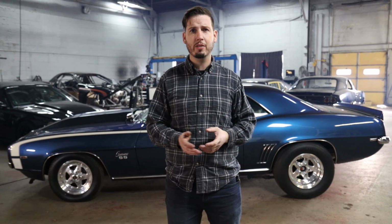What I ended up doing, and you saw it in the video, is I went in, I made some timing adjustments and just kind of verified where things were at. So the total timing we ended up running was 35 degrees. At 35 degrees of timing, and our air fuel actually stayed the same, that's when we made the 726 horsepower that we saw in the second clip.